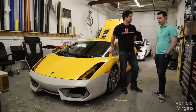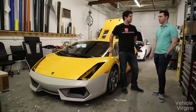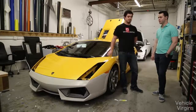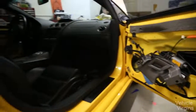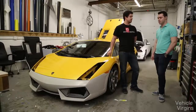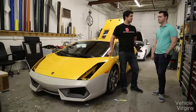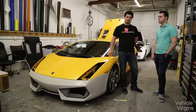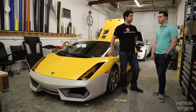How long would it take if you wanted to change it all to one different color? You're talking four days or so of solid work? Typically we can get a full color change done in about three to five days. That also depends on options — door jambs are going to add a little bit of time, and if we have a more complicated car for disassembly, that might set us back a little bit.